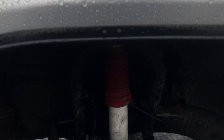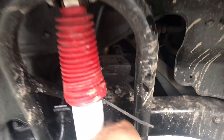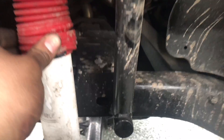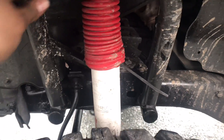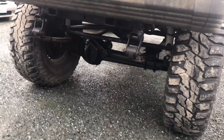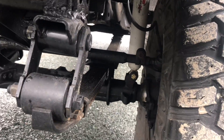I kind of forgot to record, but here it is all finished and painted — welded the shock hoops, welded the backing for the motor mount there, ground it smooth so it doesn't look that bad, and put a Rancho shock on here. So pretty much the shock hoops are already done, everything's welded and ready to go, and for now the front is semi done.